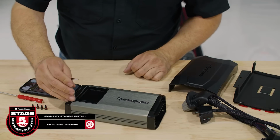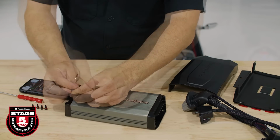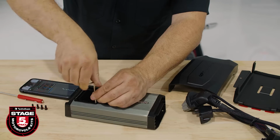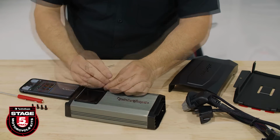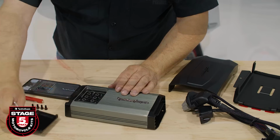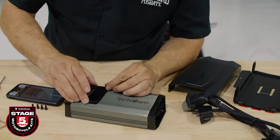Now you're ready to prep the subwoofer amplifier. Using the provided 3mm Allen wrench, remove the control panel cover. We offer an amp tuning guide that's available in the description of this video and through this kit's product details page at rockfordfosgate.com. Carefully refer to the tuning guide and adjust your settings. Once you're done, replace the cover.